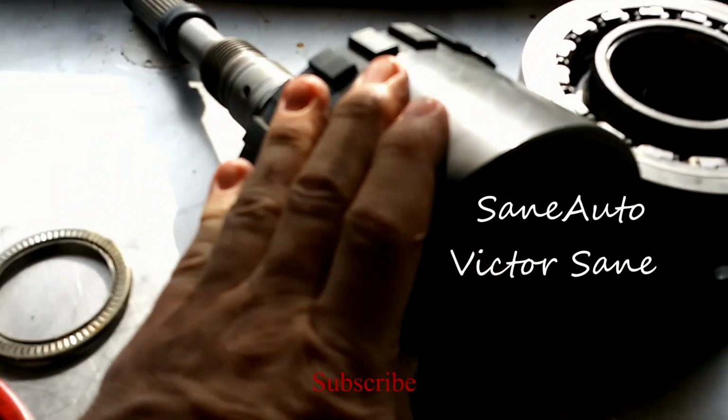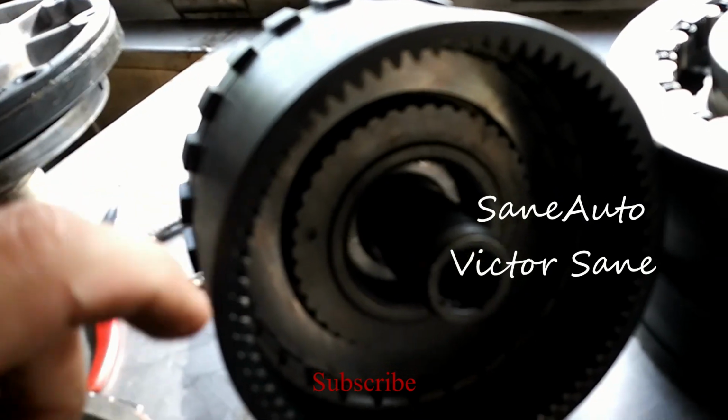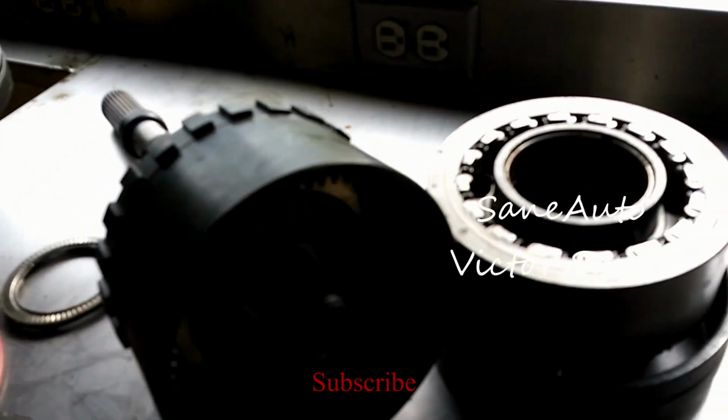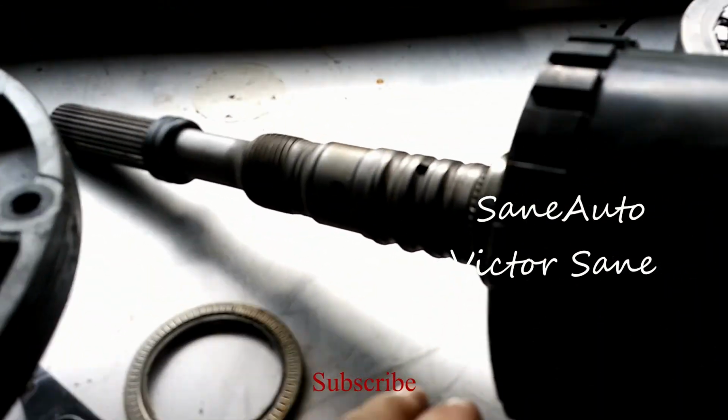Then you have the ring gear. And down inside the ring gear here, I know it's hard to see, you see the direct hub. And so I got another drum out here so you can see the drum. This is the direct drum. And the clutch pack in here is the weakest of the entire unit. So there's a lot you need to know about that.